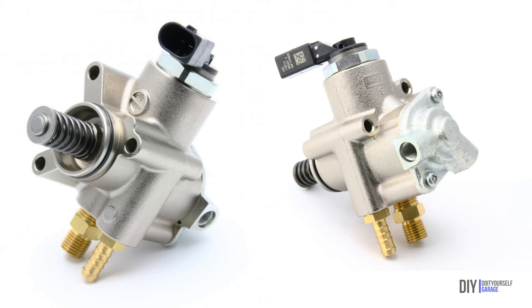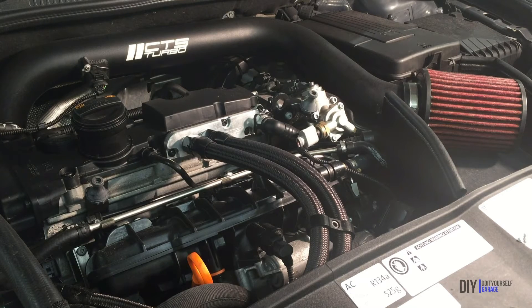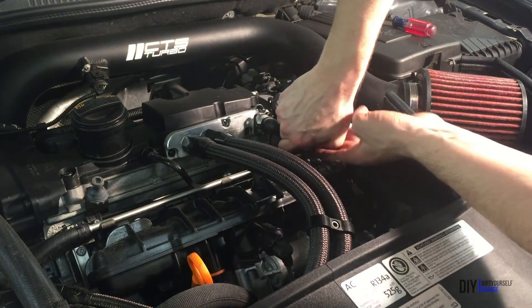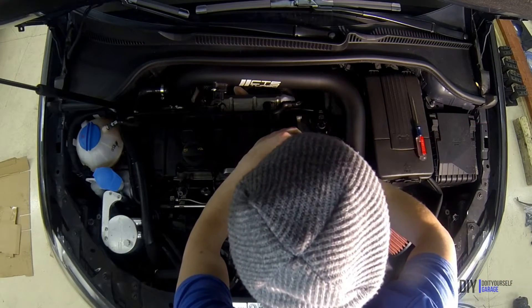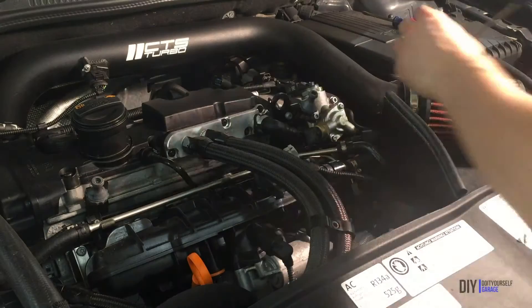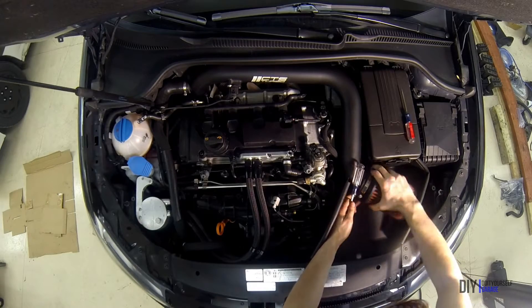Also, I'm going to be referencing this picture throughout the DIY. This should help to see what's actually going on. This image was graciously provided by Paul at Deutsche Auto Parts — check them out at shopdapp.com. So let's get into this procedure. Normally, the first thing to do is remove the engine cover and the air intake assembly. But I have a CTS turbo intake without any covers, so mine's slightly easier and I can already access the high pressure fuel pump. I unplugged the two wiring harnesses going into the fuel pump, then removed the air filter and the CTS filter box.